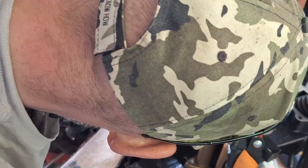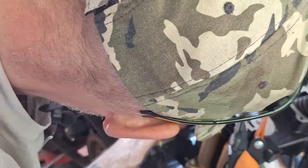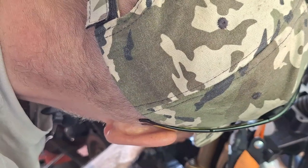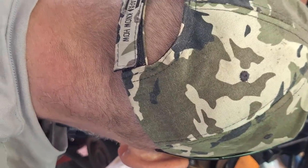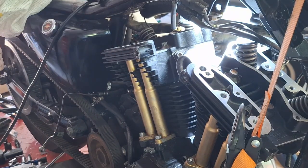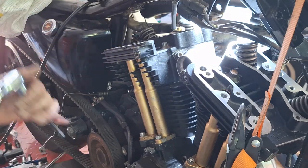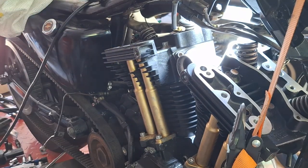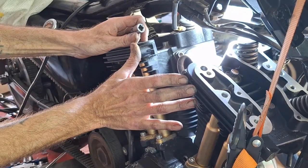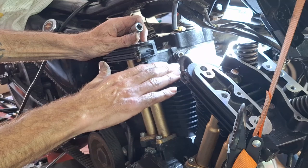It's way off — it's like five degrees. We've still got it loose. We're going to tilt it down until it's about in position, 2.71, so that should be right on. You want them as close as you can get them. When you put your carb support on, if you don't have this thing lined up, it can cock the carb one way or the other.